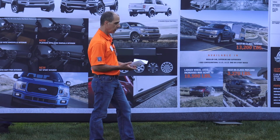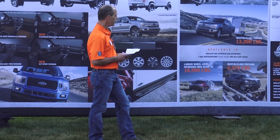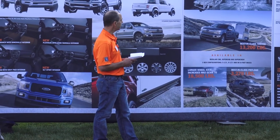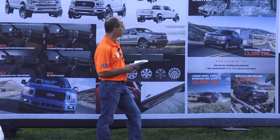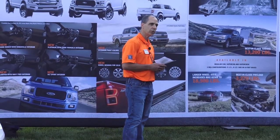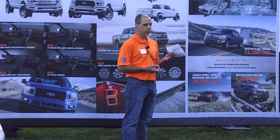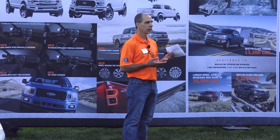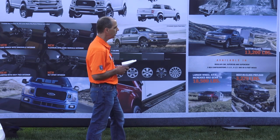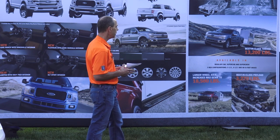We're tougher, smarter, and more capable now with the new 2018 model year. Speaking to capability, we increased towing by 1,000 pounds — so we're now best in class still at 13,200 pounds. We did that a number of ways: we increased the frame gauge on the rear end, the mid-rails of the frame were up-gaged, we increased the steering gear, and front axle tubes were up-gaged. GCW increased to 18,500 pounds. And still best-in-class payload at 3,270 pounds.